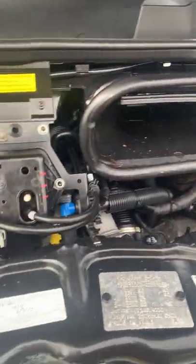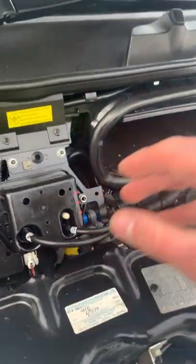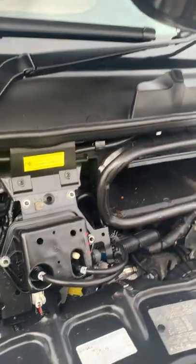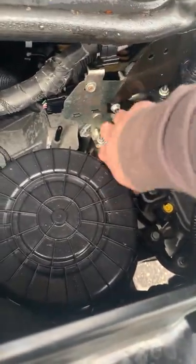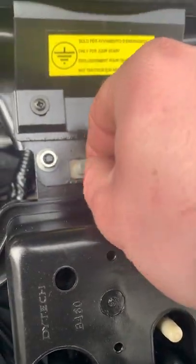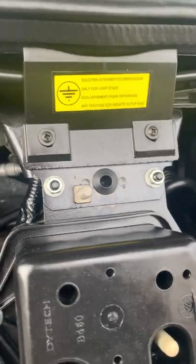Your engine battery in all of these cabs is exactly the same — it sits just in front of the passenger seat. To jumpstart the van, you've got the positive terminal under this little cap down here. Pull it open and look inside, and then you've got your negative prong just up here. It's labelled 'only for jumpstart.'